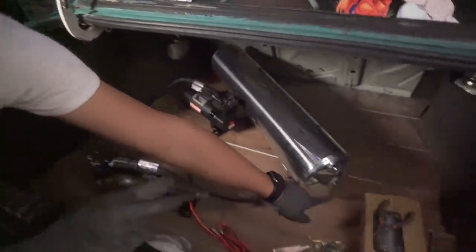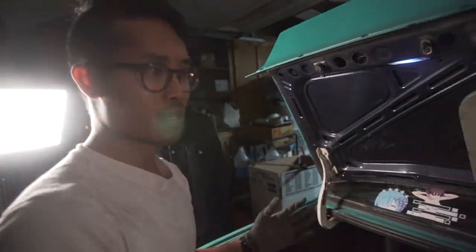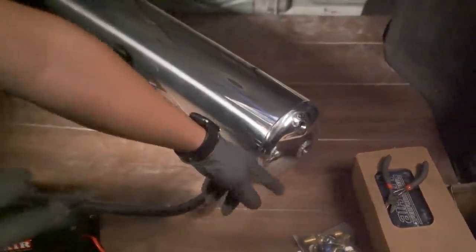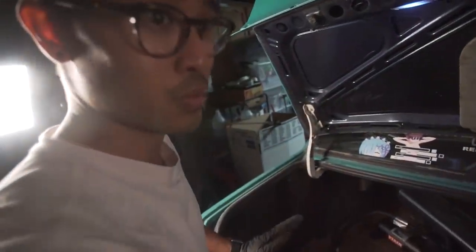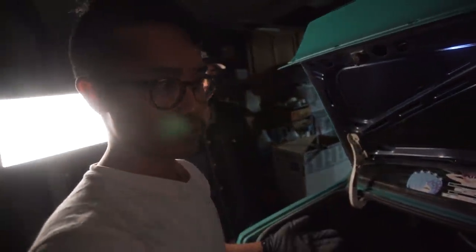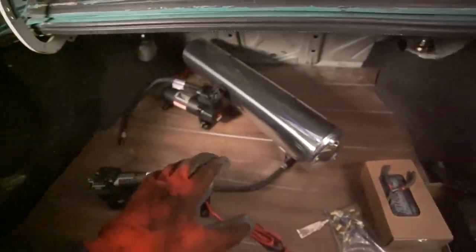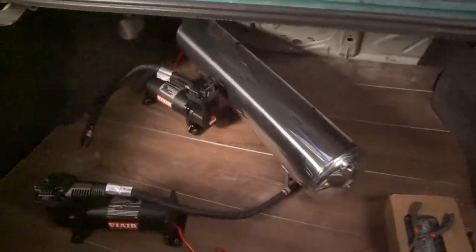And then these bottom ports here, there's one here and one there. You're gonna plug up that one, unless you use a water trap for that side, it's optional. And for this side, you're gonna use one water trap that goes straight towards the manifold. What a water trap does is kind of what it sounds like: it traps water, keeps it from going into the manifold and destroying your bag setup. Water just accumulates from air compressors naturally. As it compresses the air, water accumulates. It's not like water drips and then falls into your tank somehow. That's all just from what the compressor makes.